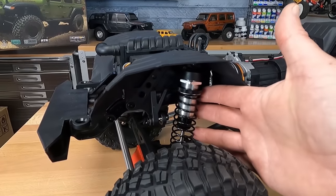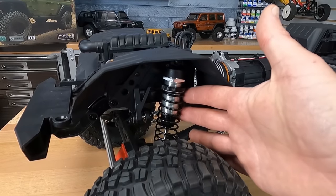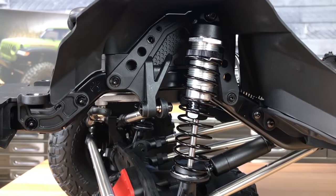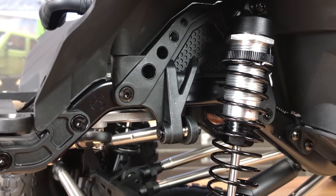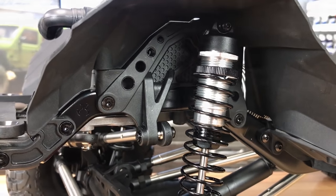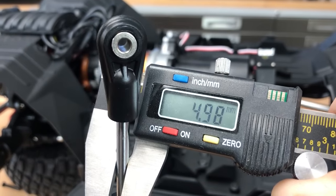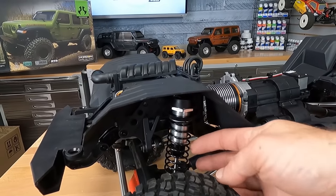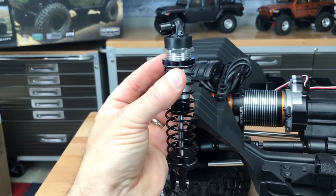So we'll start off with the shocks here, which are the same size outer diameter wise as the Super Baja Ray. Just the length is adjusted for this particular vehicle, but these are aluminum bodies, composite cap here and a machined lower cap to hold in the seals. Look at the size of the shock shaft on there, absolutely massive. But I wanted to mention they're the same outer diameter as the Super Baja Ray because the upper cap and lower cap will fit. So if you wanted to go ahead and put the king caps on there, I guess